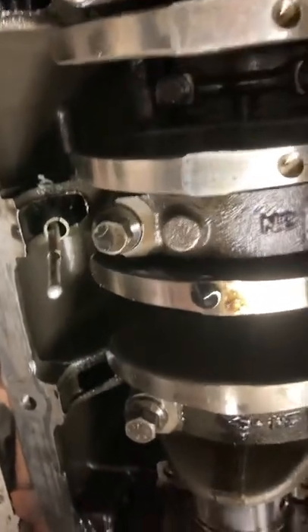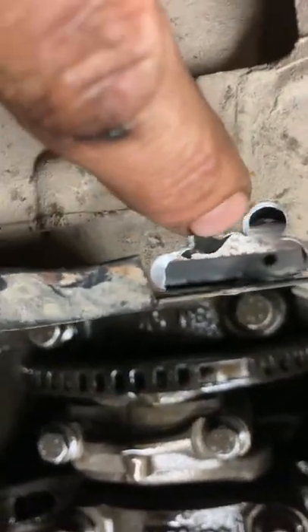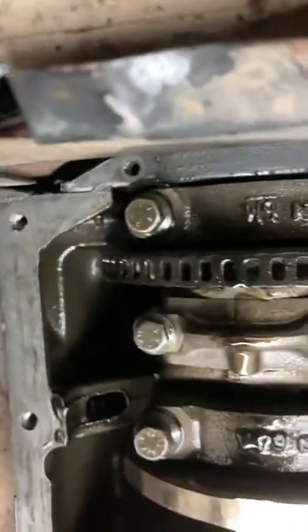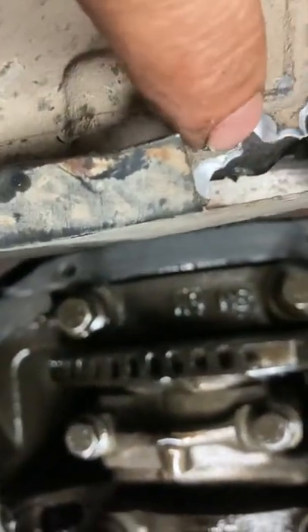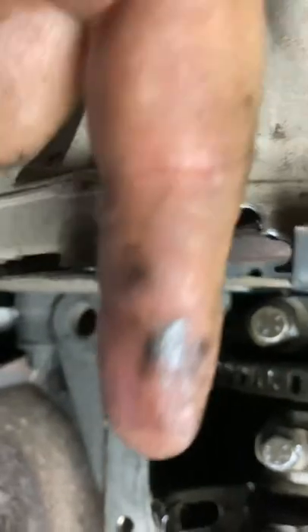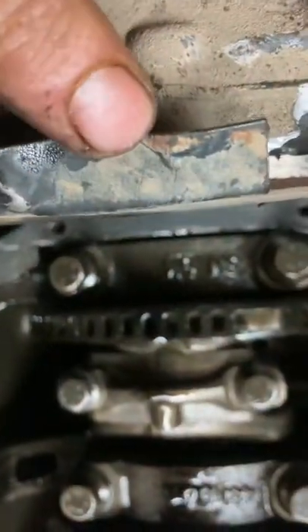Really the point of this video is to show you how to do it in terms of getting a sump off. I made a bit of a mess here — I could tidy it up with a burr but I just did that with a drill. The reason I did that is because I could feel what I was hitting. The moment I hit whatever was behind, I could stop. There's plenty of space so long as you stay forwards — if you go that way you're going to puncture the gearbox. But it's damaged nothing.